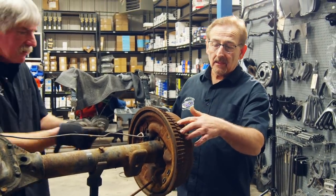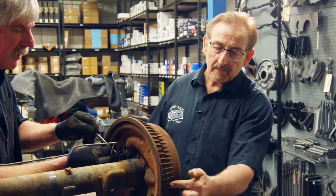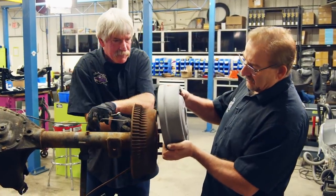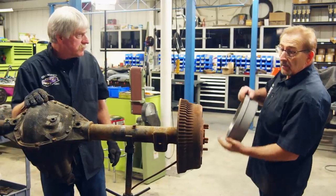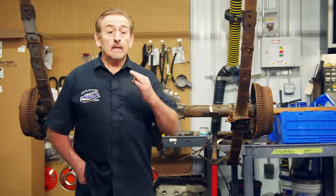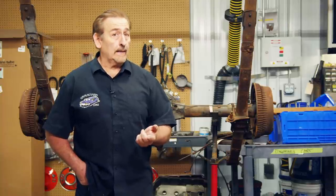At a glance, how I can tell this is an 11-inch without even taking a tape measure — you see these little cooling fins here? See how this drum doesn't have those, it's real smooth? This is a 10-inch drum. So when you go across our axle rack and see 100 rear ends, you can tell at a glance which ones have 11-inch and which ones have 10-inch. Nowhere in the book does it say anything about that. Tony told me Steve Giuliano also had 11-inch drums on his Survivor cars, but nowhere can we find where you could select 11-inch drums with power disc brakes and a 4.10 ratio.